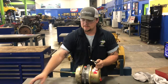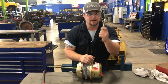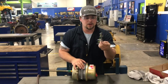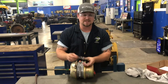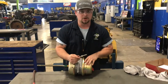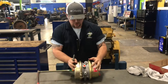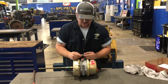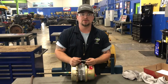The easiest way to cage these is to give it a little bit of air. If it's still hooked up to the truck, push it in, lock your brakes, then turn the brakes off and stick your cage bolt in there and tighten it down as fast as you can. Make sure you do it correctly, because if this thing goes flying out it has the ability to seriously injure or kill somebody — this thing has an 1,800-pound spring and it flies out as fast as a bullet. Now I showed you how to rebuild it and how to check your diaphragm — that's pretty much the gist of how to do it. Hope y'all have a good day, thank you for watching, and I'm Jesse with JTEC.